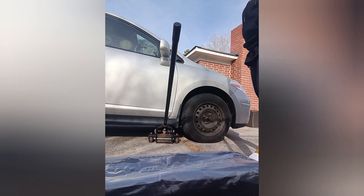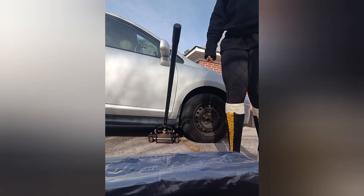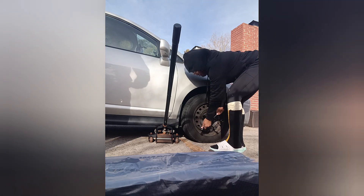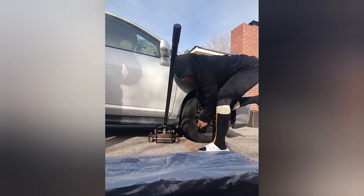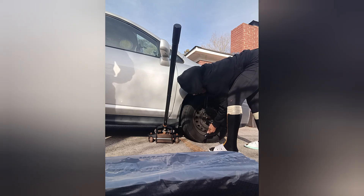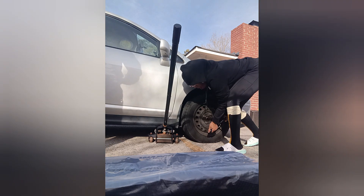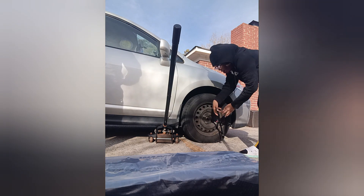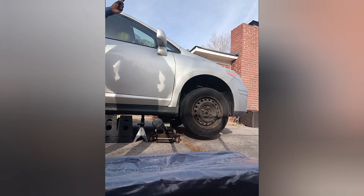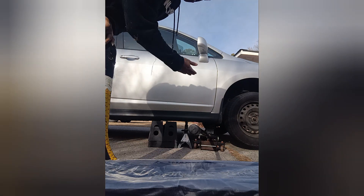Once you get that wheel off, you want to put your e-brake on in the car. Next you want to loosen your lug nuts — even tight, you want to loosen them first. Put your foot on it, pop it like that, but don't take them off yet. Now: the jack is first security, the jack stand is second security, and the ramp is third security. Three secures — let's get down to business.